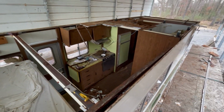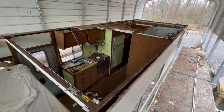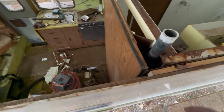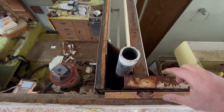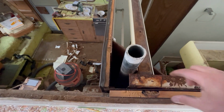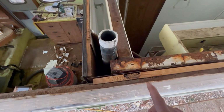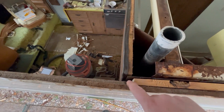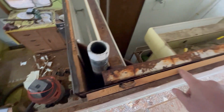Got the rest of the roof off of this now, except for that little bit of part. We got a little bit of trouble right there, but there was wood down in here that had actually rotted away, and so I've got to cover this with some 1/2 by 3.5 inches to go across here, so that we can screw here and then hold all this. So the remnant of that actually fit down in here perfectly. So I've got it all the way down in there.